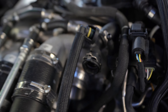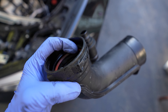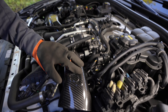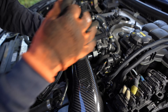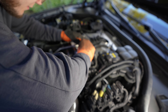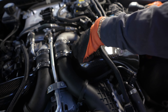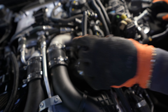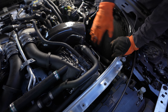As you guys can see, this turbo inlet is greased up on the inside. I think we're going to reuse this ring for the new one. One side's off — we just got to do the other side now, which should be the same process. And there is the turbo right there. Pretty small, actually. Well, it's a twin turbo, right? Quick tip: the turbo inlet — the side that goes into the turbo — there's an O-ring or a gasket. Make sure you take this out and transfer it into the new one, or else it's going to be a very loose fit.